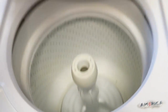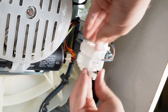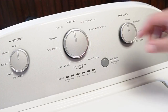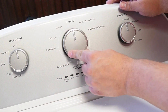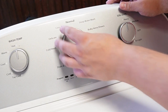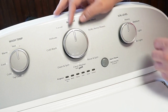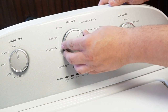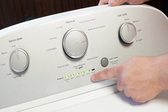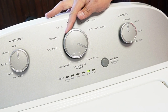Now let's attempt to recalibrate this washing machine through the calibration mode — a must-do if you've installed any new parts, from a board to a balancing rod. With the washing machine freshly rebooted, rotate the dial counterclockwise 360 degrees. Then turn the knob right three clicks, left once, then right once again. You need to do all these things within three seconds, and it may take a few attempts. If done correctly, all the lights at the bottom of the washing machine control should flash on and off, showing that you've entered into the diagnostic mode.